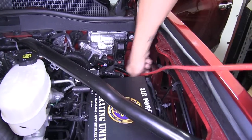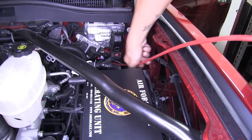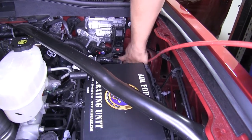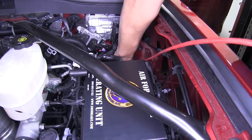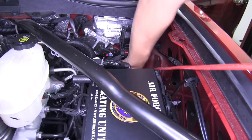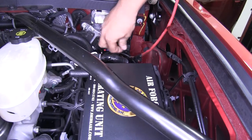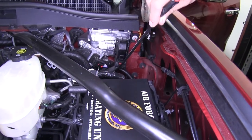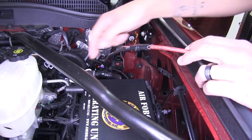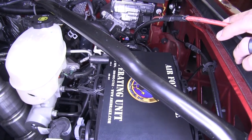Be careful when pulling it through — if you start feeling a lot of tension, go on the inside and make sure it's not getting stuck so you don't lose everything you're feeding through. If you can reach your hand in to help guide it through the grommet, that's always a good idea. Once you have some of it through, grab the chunk and start pulling it through. Pull only enough airline to reach the air out port — we can trim that down on the inside later.